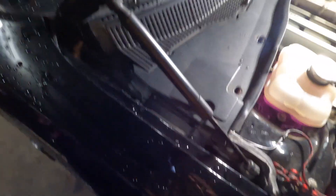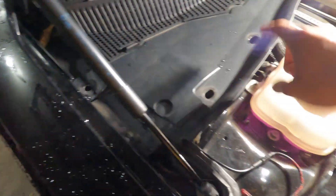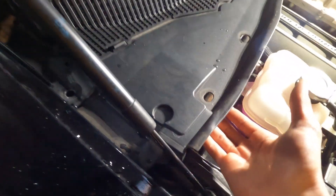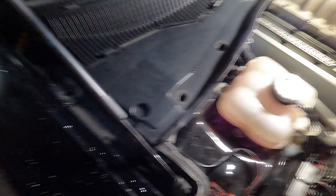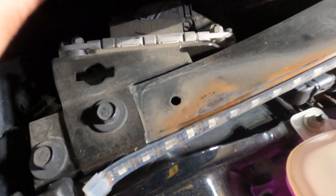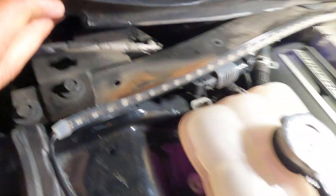All right, now we're at the front of the car. This is your passenger side — your PCM is going to be under here. You're going to have one, two, three, four — I believe five pins back here that hold this all together. I'm gonna pop them out with my trusty panel popper, and under here we can now see the PCM. You see that one 10 millimeter bolt — we're gonna unscrew that and that bracket will bring out the whole PCM.